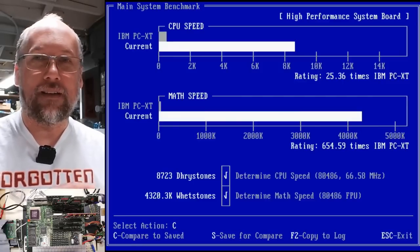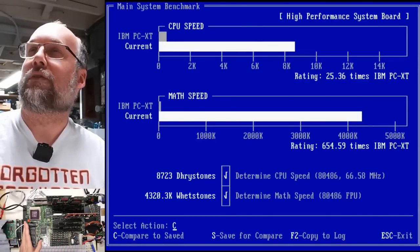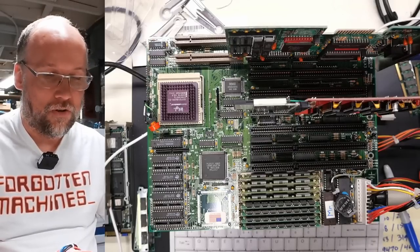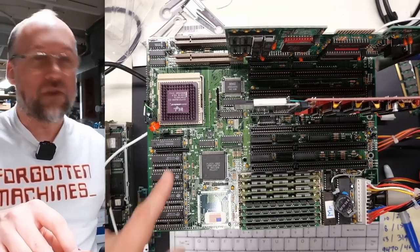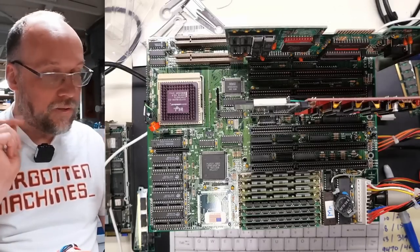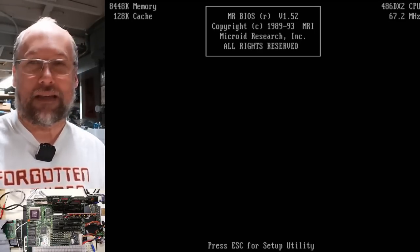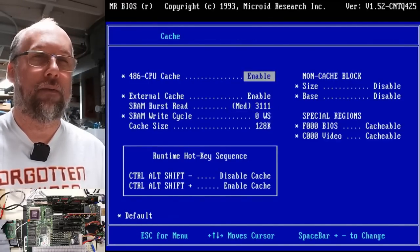Let me try to look up this motherboard. I'm going to search by the chipset. Is this it right here? A-Trend? That sure looks like it — the very first motherboard result. Yes, without a doubt, that's it. The only thing missing is mine has a 'Made in the USA' sticker. Let me try to figure out the jumper situation and see if there's a jumper for the cache. Looking at the manual: cache config, you can have either 64, 128, or 256. The external cache is working. Notice that 66 and 33 should have the same jumpers. And there is actually a different jumper setting for DX2/66, and I'm assuming P24T and C is the Pentium Overdrive. Looks like everything is generally the same except JP3. There's also CPU type selection and bus wait states.